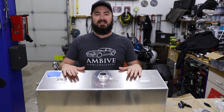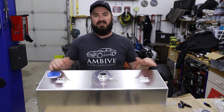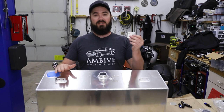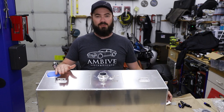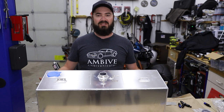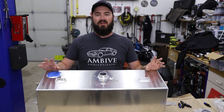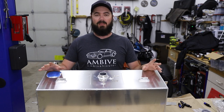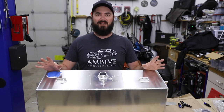In order to get this tank in the car, I'm going to have to make some brackets and drill some holes. There are tabs welded to the sides, top and bottom. However, I must use some spacers to build extensions on the top to bring the tank up to where it needs to be to meet the body mounting points, and I need to drill the sides and bottom to locate to the current factory mounting points. This is going to take some finagling, so let's skip to it being complete.